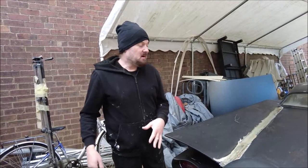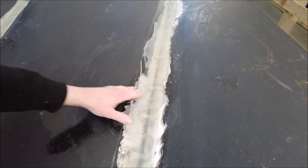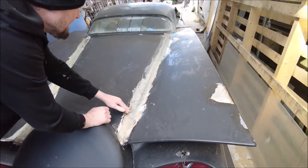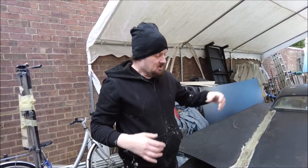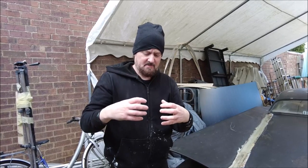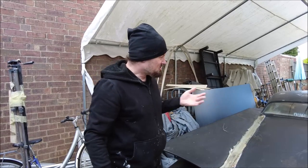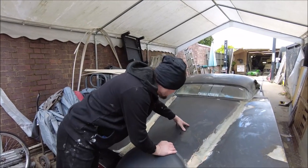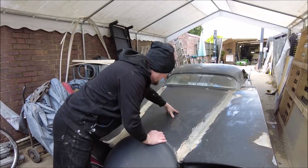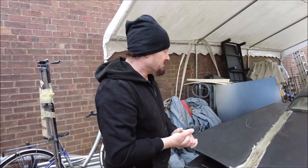It's been overnight and Dualatron's boot has dried. This is the bit that yesterday was just flapping about, but now it is absolutely rock solid. Got a really good key to that aluminium, really good wetness from the fibreglass getting in there. It's just like a different boot lid — absolutely rock solid, no more flapping. Although this bit still has got flex to it, so we will be fibreglassing over that just to make sure we have no cracks or problems in the future.